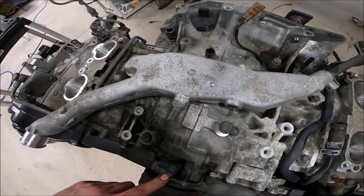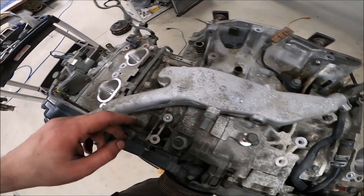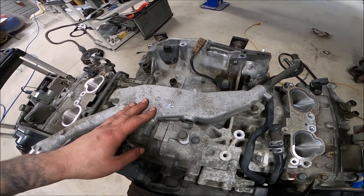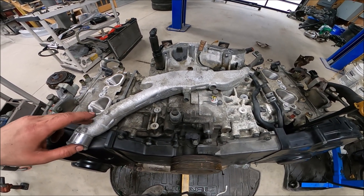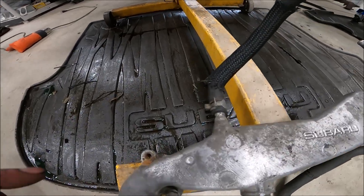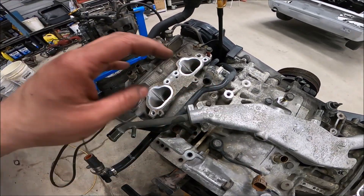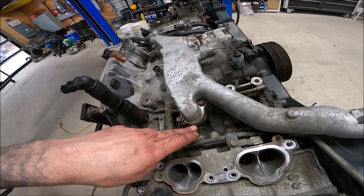Your cam sensor, your crank sensor, your oil pressure sensor — they can all remain. Same with the solenoids, they can remain. We have everything off. This is the original coolant crossover from the 20X. For some applications you could leave this crossover, but for this particular one it is not the same — his original one has a tube coming out here that goes around to the throttle body, whereas on the 20X the throttle body is actually offset over here. So we're going to take this off. When you take these off, always replace your o-ring underneath.